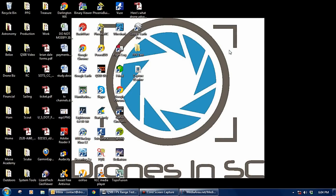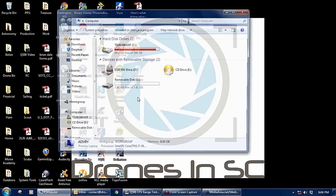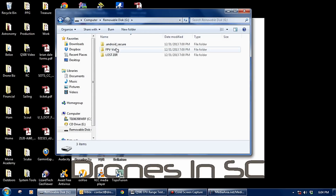The last thing I'm going to show you is how to recover the video file saved to your SD card within your ST-10 controller. After you've completed your flying, go ahead and turn off your controller and your Q500, remove the SD card, and insert it into your computer or card reader. You're going to come up to three folders — pick FPV video and then pick local. This file is an AVC file.